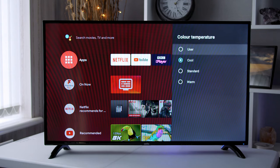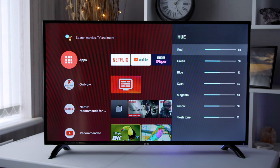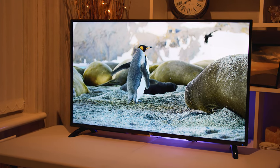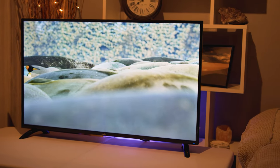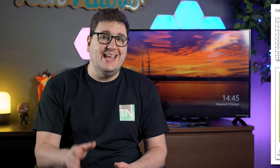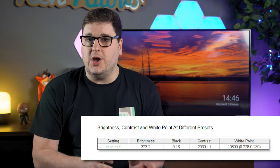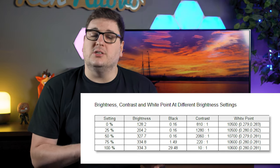The usual controls you can expect are backlight, brightness, colour, and sharpening, but to see manual controls over colour temperature and individual colour strengths was pretty impressive — it means that you can really fine-tune your image to your liking. Watching Our Planet on Netflix, you can instantly tell it's at 1080p rather than the super sharp 4K picture we've come to expect, but the actual picture was pretty sharp — I was very surprised. To run the TV through its paces, I used our Datacolor Spyder X to test various aspects. The TV performed best at around 50% brightness, especially when contrast ratios are concerned. Cello claimed the TV has a contrast ratio of 5,000 to 1, but through testing, our panel came closer to 2,000 to 1.